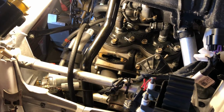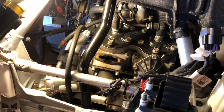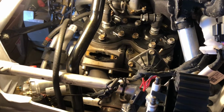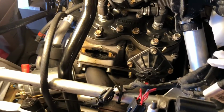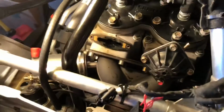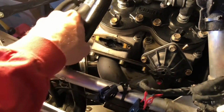Hey guys, so here we are working on a 2017 Polaris Switchback Assault 600. So it's an Axys chassis, the 600 engine that has the electronic oil pump. I don't know if that's what the differentiating factor is here, but the steering stem, the one with this particular bend in it, doesn't give you enough room to clean your exhaust valve. So even if you've taken the pipe out like I did, you still can't get this exhaust valve out without doing something with the steering stem.